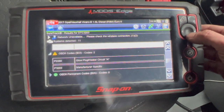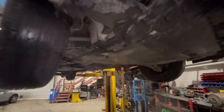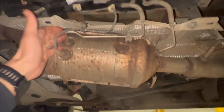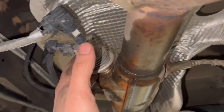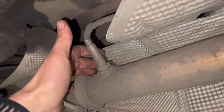With the vehicle up on the ramp, coming underneath from the front just to the back of the under tray, we've got the DPF here. The DPF has a couple of temperature sensors in it and some pipes for the pressure sensor — you can see the pressure sensor located up there. We've got the AdBlue injector on this side, NOx sensor number one at the front, and further down the pipe we've got NOx sensor 2 located here — 22mm spanner to undo it.